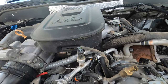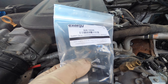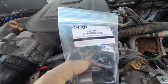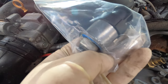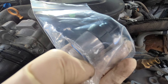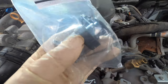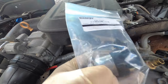Right now I've got the bag wet. We're going to be installing an Exergy fuel metering valve. This is the valve that goes inside the injection pump on a CP4. What this does is it has a really tight micron screen on the bottom that prevents metal from actually going into the high side of the pump and contaminating the high side of the system. With this valve installed, it keeps the metal in the pump and pushes it to the tank.